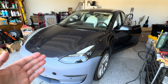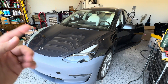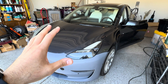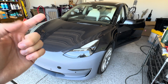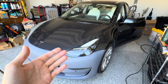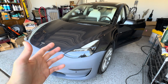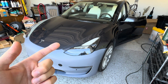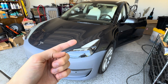Welcome back to the channel. In today's video I'll show you how to recalibrate, rebalance, and test the high voltage battery in your Tesla. This car I bought has almost 70,000 miles — I bought it salvaged from the auction — and the high voltage battery was dead, flat at zero percent charge for four to six months. I'm hoping not too much battery degradation or damage happened. Today I'll show you a process that will rebalance the cells and modules in the high voltage battery pack.